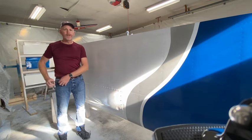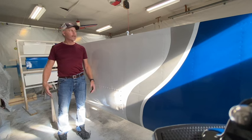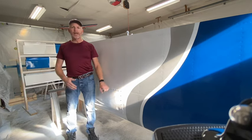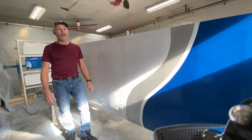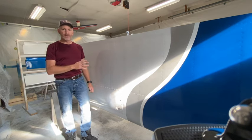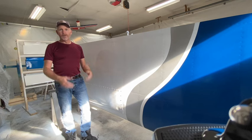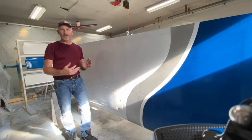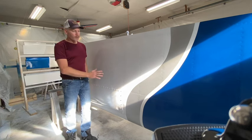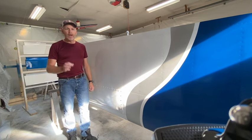Welcome back. The painting is all done, I'm cleaned up, and so is the airplane. Overall I'm pleased with the results I got in my garage. I did have to color sand; there were a couple of taping mistakes that I had to go back, re-tape, sand, re-spray, and re-clear. All in all I have about 25 hours start to finish on the paint — that covers wings, all tail surfaces, flaps, ailerons, fairings, screw heads, and various other things. Yours may go faster or slower; I did have to redo some things.